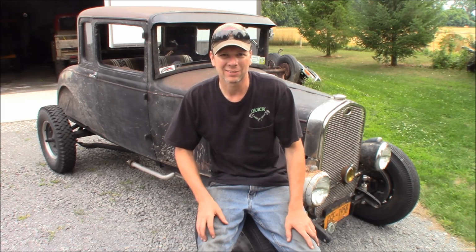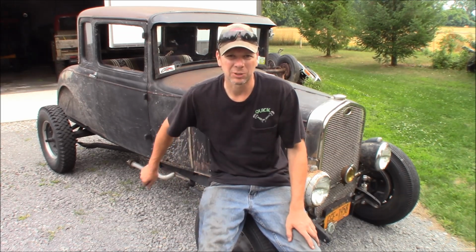So I guess I'm back on the road for now, fingers crossed. Okay, I've gone ahead in the future one day. The coil is the issue. I blew the fuse twice. I was going to cruise night earlier today and blew the fuse about a mile away from home. And then I got back here and it blew it just coming around the backyard. I put my hand on the coil and the coil is getting hot. So I'm going to guess that the coil is faulty. So I had to use my jumper wire to fire it up to get it around here to the backyard.